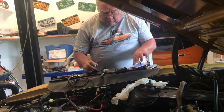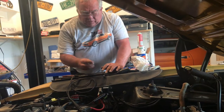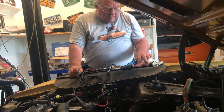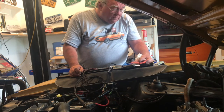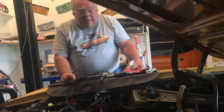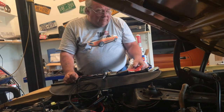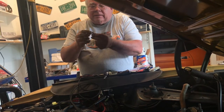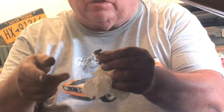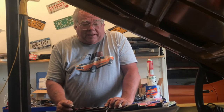We had a leak in a new area. And I took off the clamp thinking maybe the clamp is too large a diameter for this fuel line. The size clamp says it's for 5/16 to 7/8 inch hose. That's a 5/16 fuel line hose. It should have worked. If it had been too big a hose, the saddle, which the tightening screw goes into, has an arc that would not be tight enough to seal properly if it is too large a hose clamp.